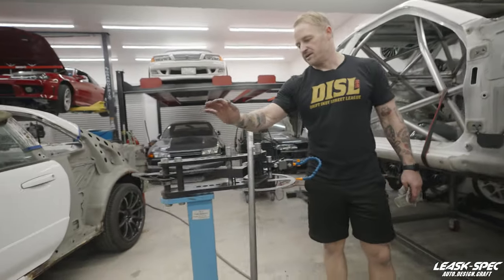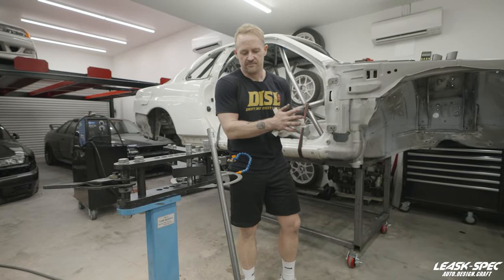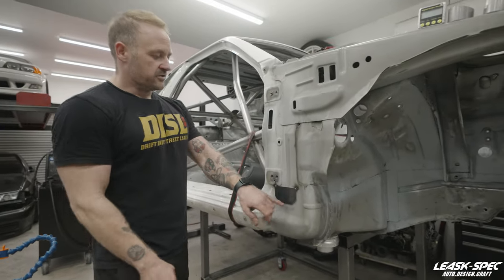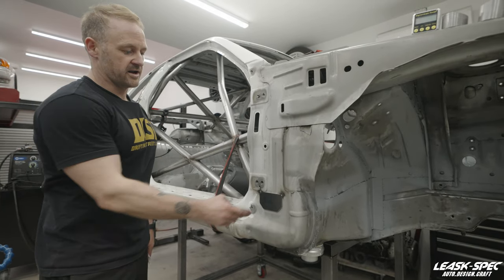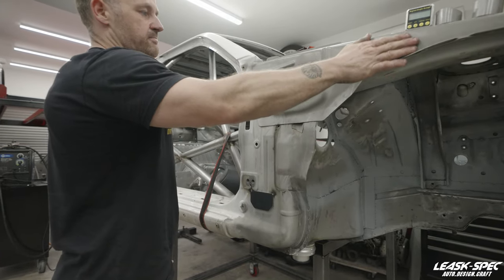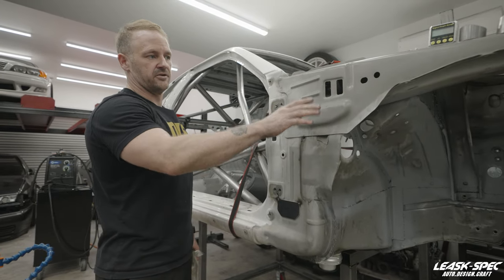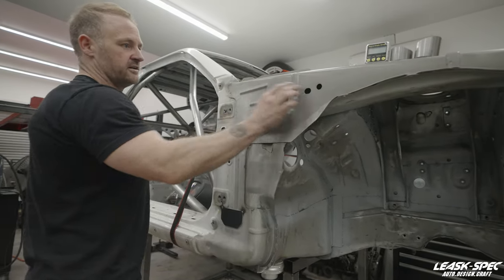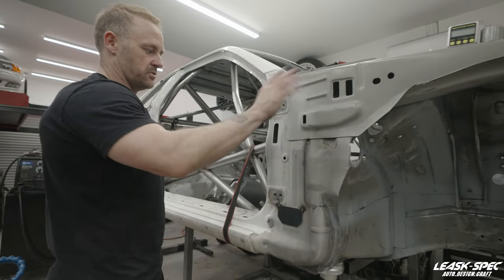You'll notice the tubing bender is set up with a smaller die because I'm taking care of some projects that have been lingering for a bit. First project is going to be triangulating the fender brace point. I was welding on my first base plate and realized I am out of gas — so kind of crappy timing for that. But I've got a plate here, a plate here, and a plate here, and I'm just going to build a triangulated setup and get some strength back into this upper fender point. As this project moves on, I'll probably take some B-roll footage of some of the fabrication steps, and it's going to be kind of like a nodule setup because I've got very tight clearance where it has to sit inside the fender. I'll go more in depth on this later.